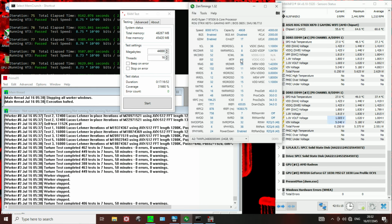So yeah, that is another concern, but I don't know how I would go about testing that. Anecdotally, I've run into the same thing with Z790, where I have three Gigabyte boards that should all be the same memory topology, except one of them is noticeably worse than the other two. So with DDR5 at speeds this high, I'm worried that a good motherboard might just be a statistically more likely to work motherboard, right? And then of course you have the CPU issue, where some CPUs just don't work at DDR5-8000, like my 9950X.